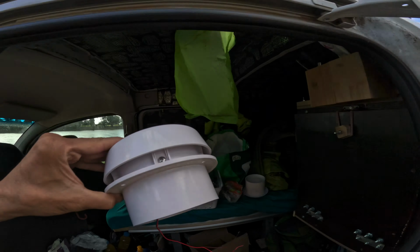So I just drilled out my roof with a hole saw. It's also got a pilot drill in the middle, which you drill through first. It took a little while because it's only a simple 12 volt drill, but it got through. Got to wait about an hour for that to dry. The glue seals out water, works on wet and oily and dirty surfaces. Sealed it all clear with that.